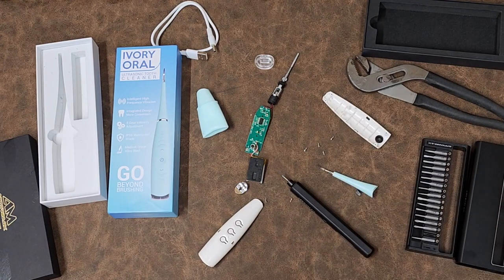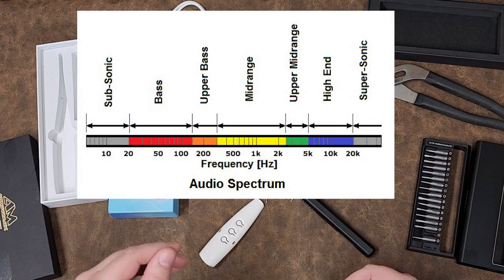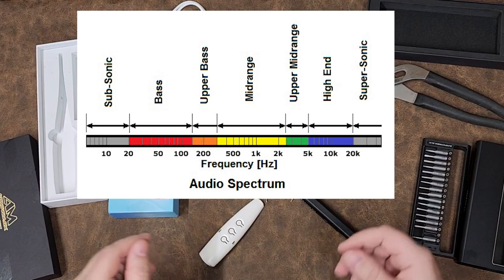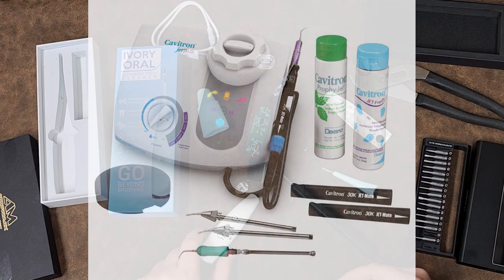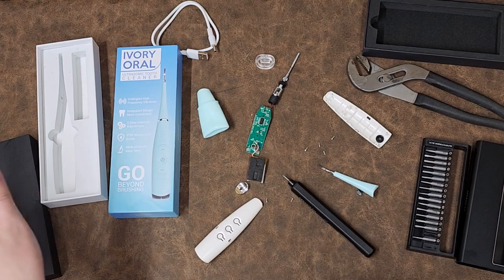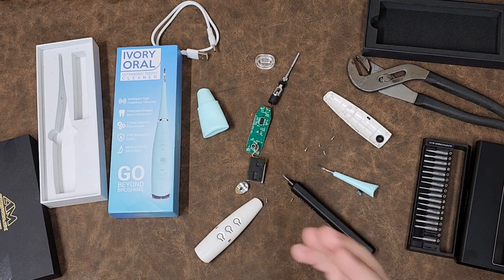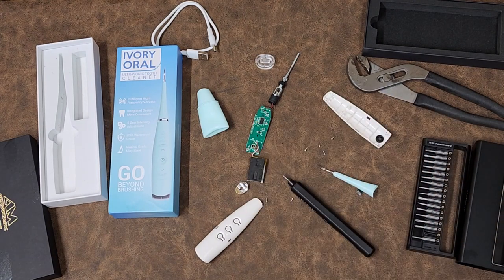Complete gag — it's a waste, it's a scam. This is a teardown of an ultrasonic tooth cleaner, and unfortunately it's not even ultrasonic. Sonic ends at around twenty kilohertz, and twenty-five to thirty-five kilohertz is normal for a real ultrasonic prophylaxis. This one at only eight to nine thousand RPM is not ultrasonic — that's sonic. You can actually hear it vibrating. Thanks for watching — give me a thumbs up and let me know if you have suggestions for future content.